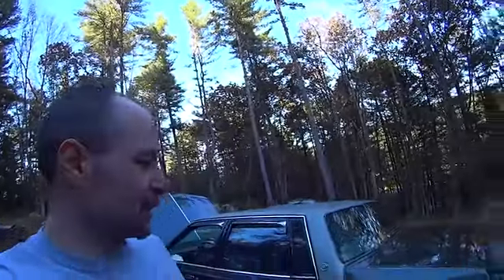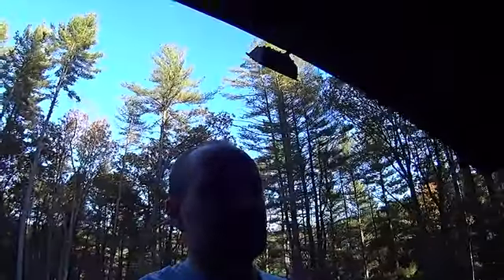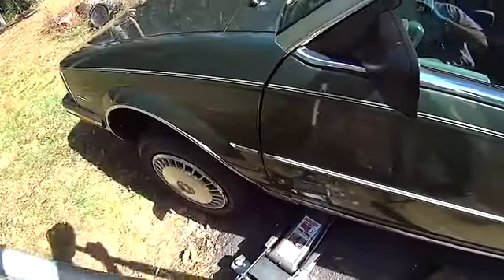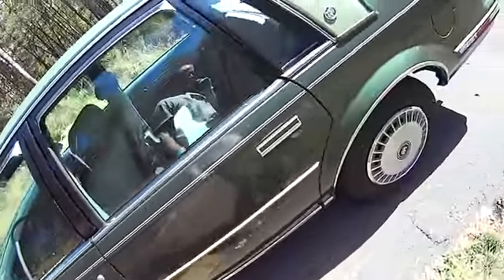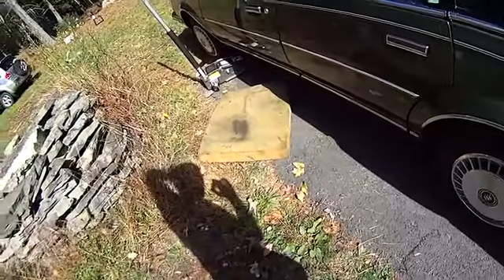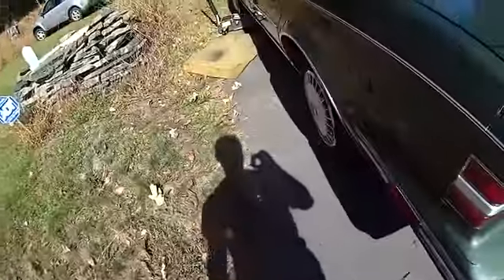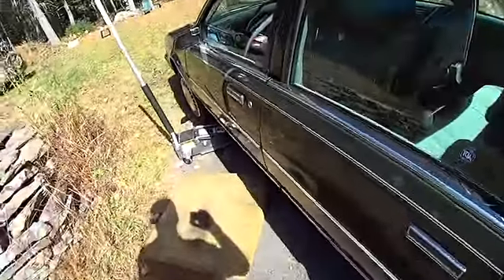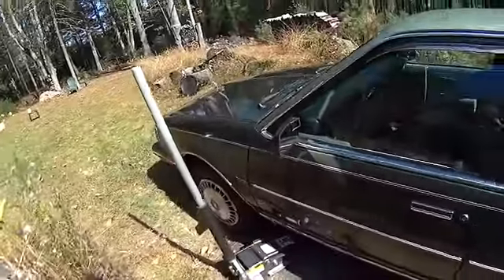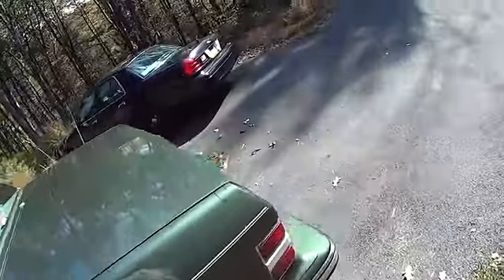I love working on cars like this because I don't need computers or anything special. Just working on the Buick — checking all the bearings, ball joints, lower ball joints, tie rods — everything is great. The bearings are beautiful, spin very smooth, rock the wheel and there's no play anywhere. It's only 59,000 miles. I thought I would have to replace some of these parts, but no, everything is good.